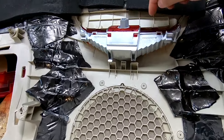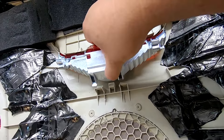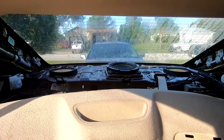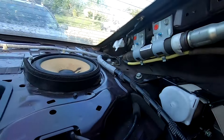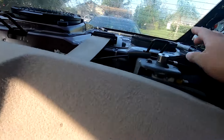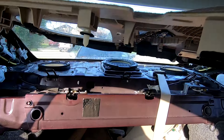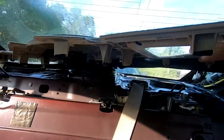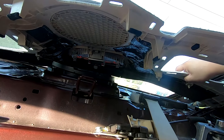Put the brake light back in — line this up, tilt forward first, then tilt back and it locks into place. This is probably going to be the hardest part of the entire install. Make sure the white clips on both sides haven't fallen off and that you have all your retaining clips ready. To get the rear deck back on, slide one corner in first, then come up and over, and slide the other corner — you can see we're clearing the subwoofer with no issue.